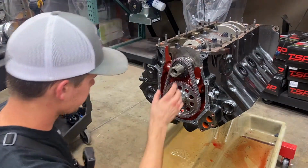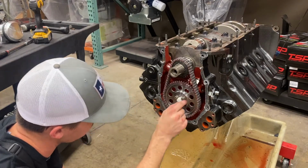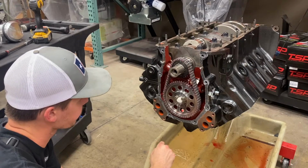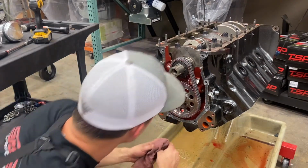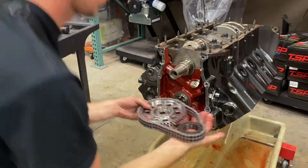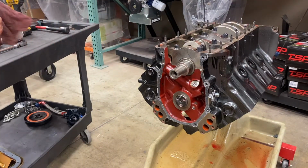Okay, so our adjustable cam gear is installed at 0 degrees, and it looks like we've been degreed at 111 1/4. I'm guessing lobe separation angle, maybe intake centerline. Take these bolts off, see what we got. Come on. Roller bearing, nice piece, and let's get the camshaft out.